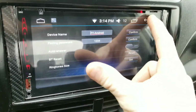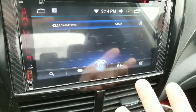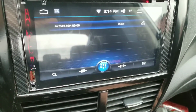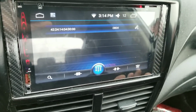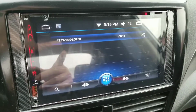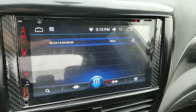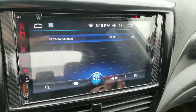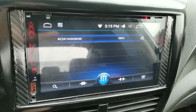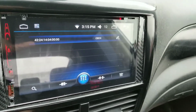So when I went to connect the thing, it would say unable to connect due to, basically, wrong PIN or password. I'm like, fucking bullshit, because this phone is working and now this thing's not. So what is my deck, junk or something? But no, it's totally ridiculous. My phone's default password is the same as everybody else's for Bluetooth when it's visible, okay? So for some stupid reason, this has to be visible. So that's probably your issue 90% of the time. And I didn't even know that. So I've spent days trying to figure this out. And I was going to throw it away and buy a $30 controller, and I'm glad I didn't.